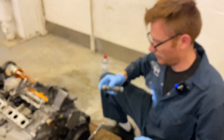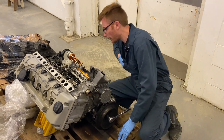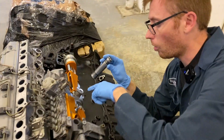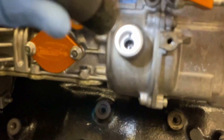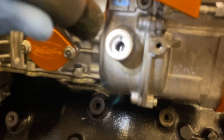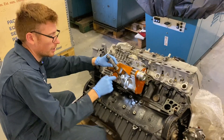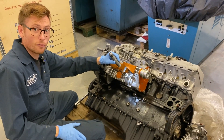So I'll take the camera again — I think I might have been holding that in portrait mode, so apologies. Then we just have to check: is the pointer in the hole for the pump? No, it's not. So this chap's running problems are probably right there. With that at 11 degrees after TDC, his pointer should have been there. I think that problem is solved straight away.